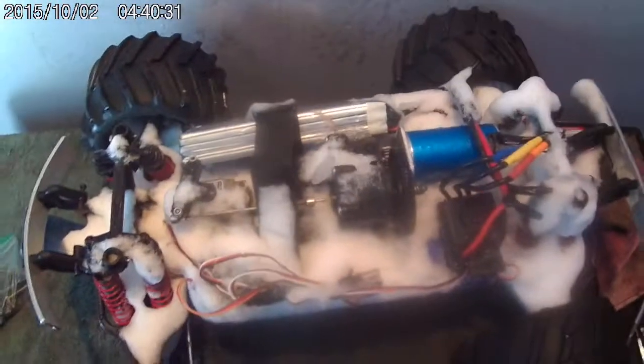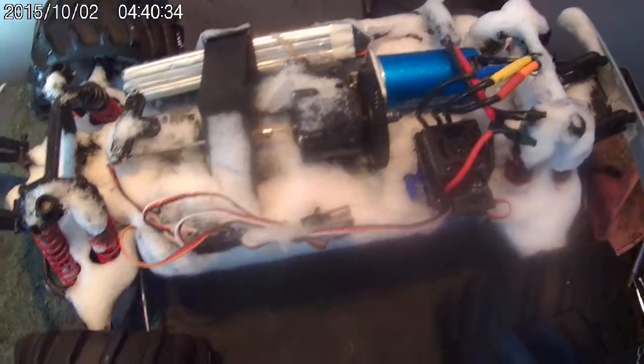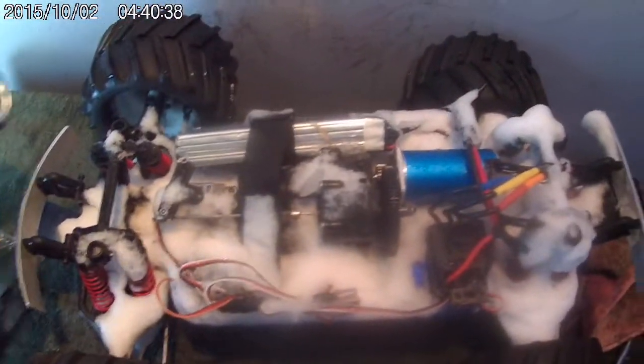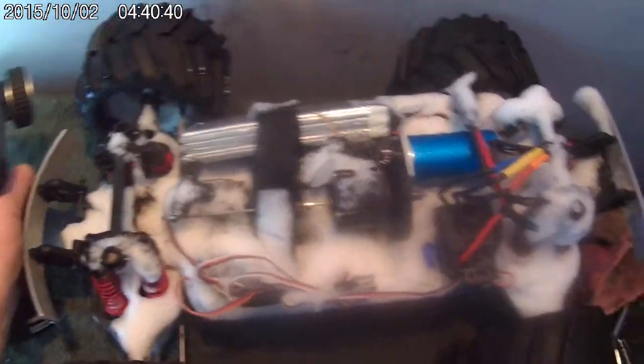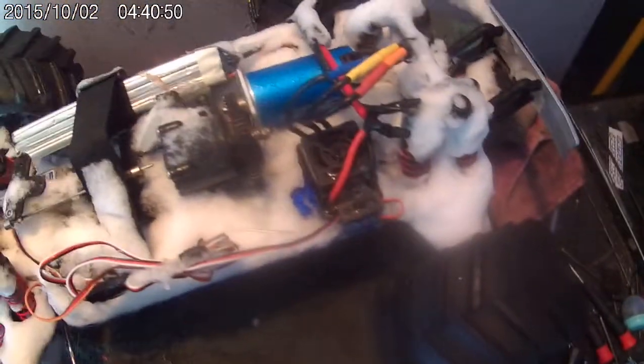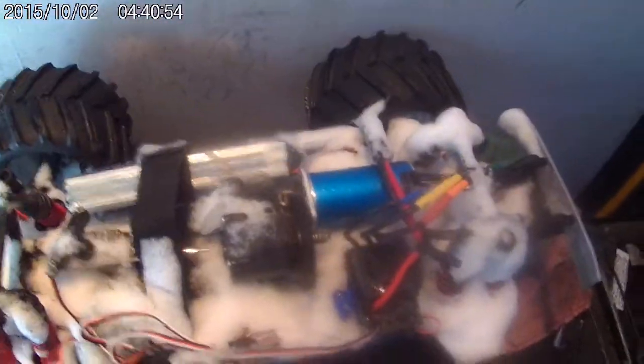I still have the two-speed in with reverse, so RPMs have to hit, but I'm going to throttle it so you guys can see. The ESC does still work — everything works fine. Reverse won't kick in because it's not direct drive, but everything works. I put a 2200 one-eighth brushless motor in, like I said I was going to.